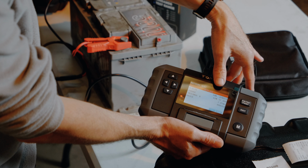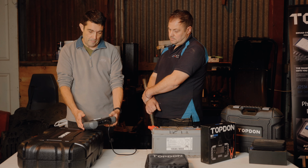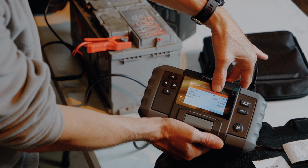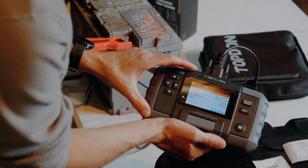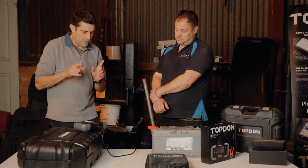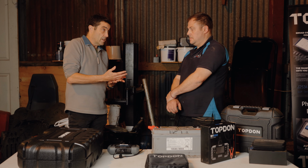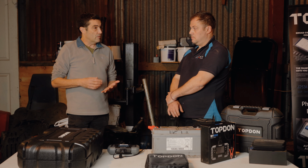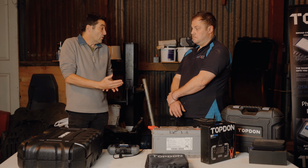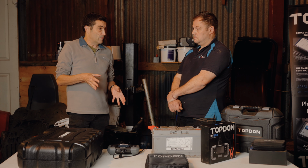So that's not looking very good. It's saying despite 12.39 volts here, we're looking at a charge of 64%. So 64% charged up. And then the worst thing is it's 18, this is 18% health. From the point of view of that, telling you that, you know for a fact that if you start your car in the morning on a cold day and you've got your lights on and your heaters on and everything else, then if it's a diesel, you've got your glow plugs, which you need warming up on the battery. That's before you crank the engine over.